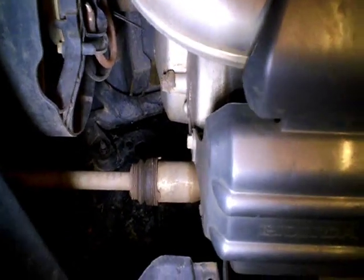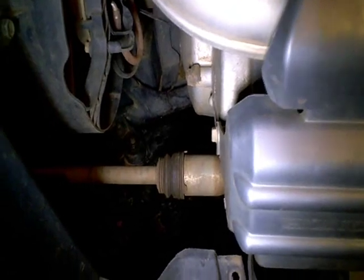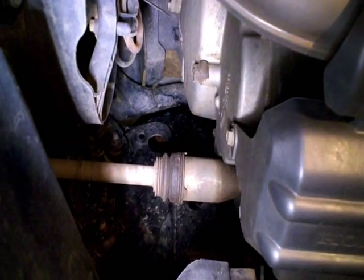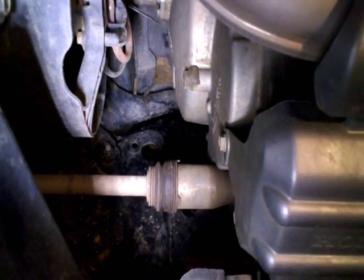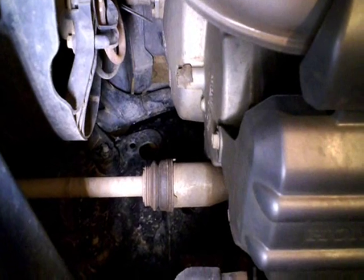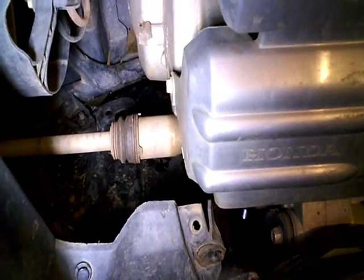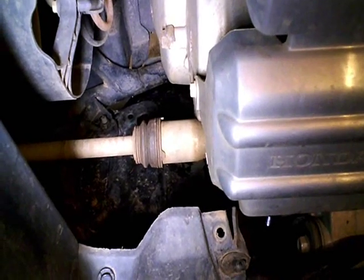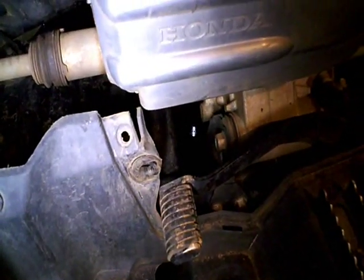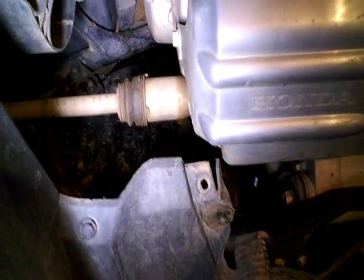And in the center of that hub is a Sprague drive, or like a one-way drive, like a ratchet. And that allows you to have engine holdback going down hills even when the engine's at idle speed. And then the second clutch, which that adjustment is for, is called the change clutch. It's very similar to a typical motorcycle clutch with a basket of friction plates with clutch material on it and clutch plates, metal clutch plates. And what that does is whenever the shift lever is a little bit out of the center detent, it disengages and allows you to complete the shift. So the adjustment there keeps the clutch from slipping if there's not enough play, or if there's too much play, then when you push the shifter you'd start trying to move gears against each other before that clutch is released. In other words, they'd still be under pressure and that'd make them difficult to shift.